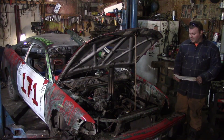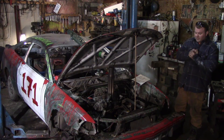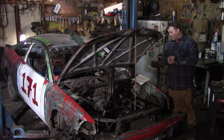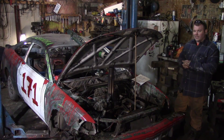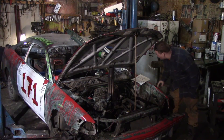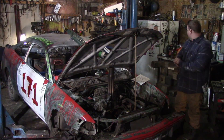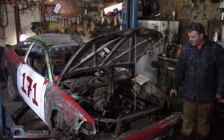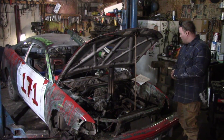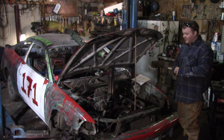So there is a lot left to do on this thing and there's really not that much time. I'm just going to basically start knocking stuff off the list. This is about all I think that there is left to do on this car — there's probably a little bit more I'm not seeing, and I think I need to do the rear brakes on this as well. I'm going to start with the rad padding — put a piece of foam across the front of the rad to cushion it from big blows from other cars, then knock off some of the easy stuff first.